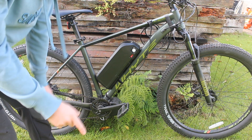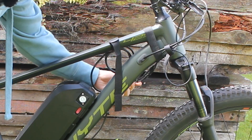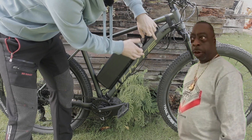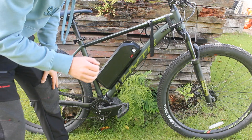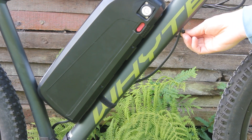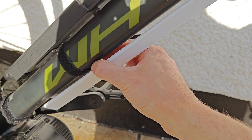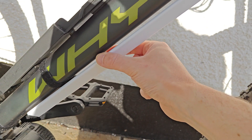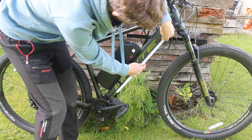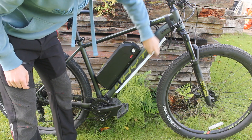I'll start with the problem: I don't like these straps. All of this loose cabling just hanging around — I wanted a way to manage that mess. I have two extra screw holes, and there are three holes total, so I'm going to have to install an extra rivnut under here to hold this in properly. This will sit on those screws and clip into place.